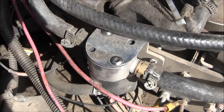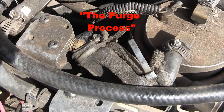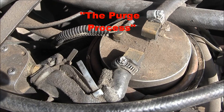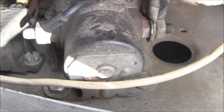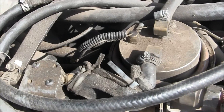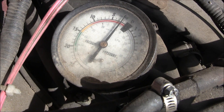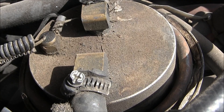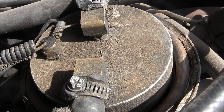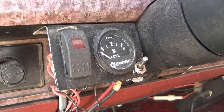There are two solenoids: one switches from diesel to vegetable oil, and the other handles the return line to make sure that when you finish at the end of the day, there's no vegetable oil left in the fuel lines — it's all back to diesel. It's grounded here on the side because you never want the solenoids to get ungrounded and not work. There's also a pressure gauge that tells me when the filter is getting too clogged. In my case, I change the vegetable oil filter about once a year, roughly every three to five thousand miles.